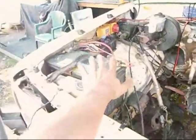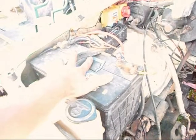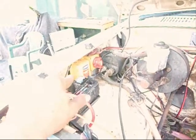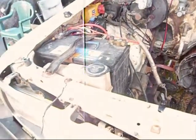This is the main battery here, so they travel across here because it goes through a standard dual battery system. This goes through an isolator unit, so this battery gets charged by the solar panel. Once it's charged up, this charge control then recognizes that this battery is charged. It flicks over and allows this battery to then trickle charge this battery here. So the system makes one battery the priority. Generally speaking, they're set up that way so you always have enough power to start up your engine.